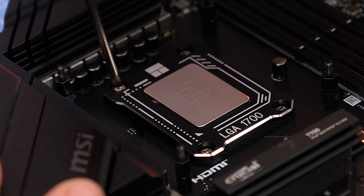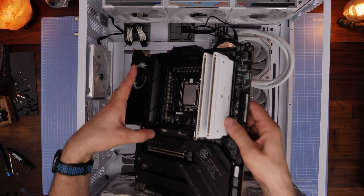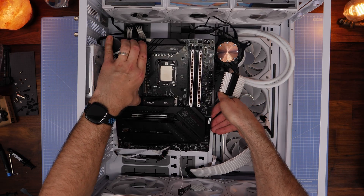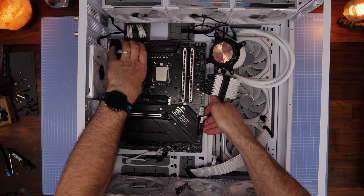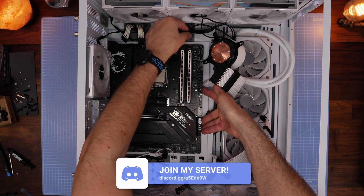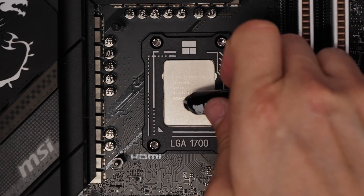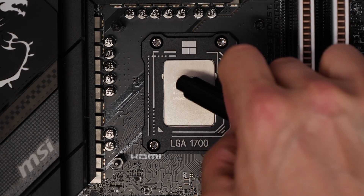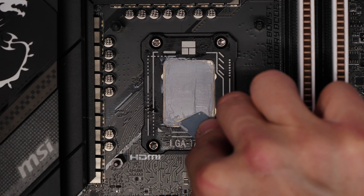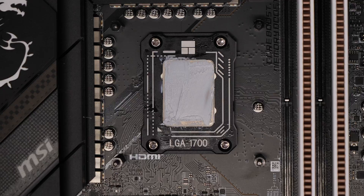This is a good way of keeping things neat, but also applies pressure in all the right places to theoretically keep this cooler over time and improve the longevity of your system. So just re-screw it down and tighten it back up. Then you need to put the system back together — you'll notice I've cleaned up the CPU pump as well, so the all-in-one cooler has been cleaned up so there's no thermal paste on there. Then we'll need to obviously plug everything back in. I've got a detailed wiring guide for PC building linked in the description if you need it. I'm going to use some Thermal Grizzly Kryonaut thermal paste, and I like to spread it out to make sure there's thin coverage across the entirety of the CPU. Then we just need to reinstall the pump back over the top and connect everything back up.